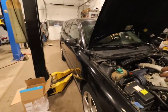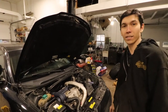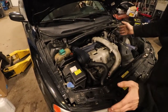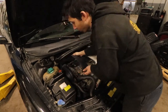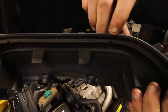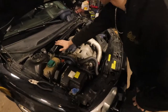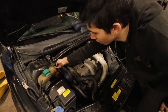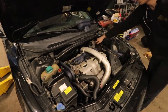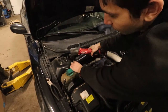You do have to pull the wheel to get to some parts, but we're doing it on the lift because we have access. Next step, we want to get all the stuff in the way out of the way for the timing belt. We'll need this piece because these are the timing marks — zoom in on those, that's one, that's another timing mark. Take this off — there's a nut down here and a bolt, or you can do the four bolts, two on each side, and then the one that goes through here is a 16.